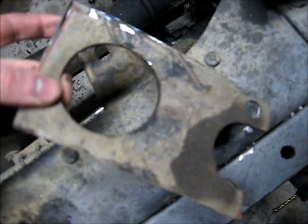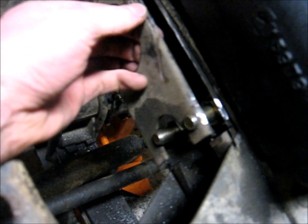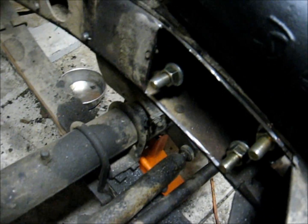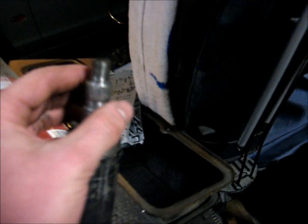I'll cut this out of the frame because there wasn't any way to really secure that like that. So I'm in the process of mocking up for a backing plate here. The other problem I ran into was the splines on this are gone, so I can't use that shaft anymore — not even modify it. This is a steering column out of a 1979, and I'm going to use that and modify it to fit this.